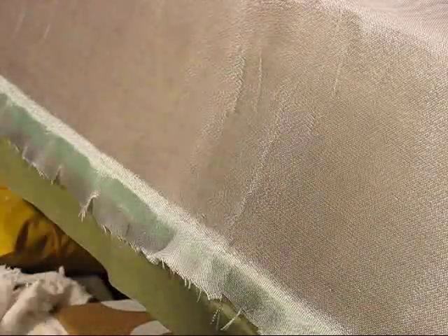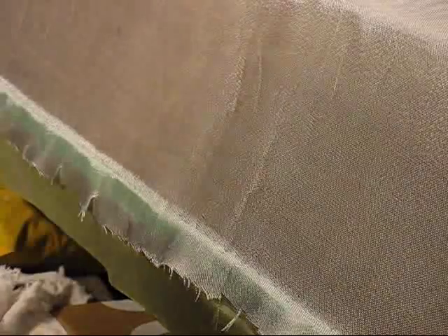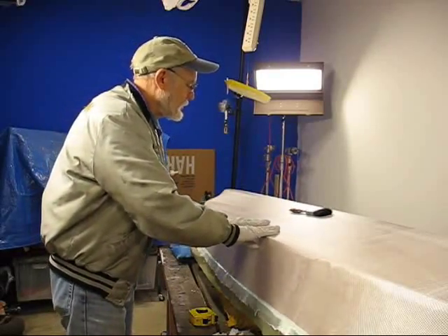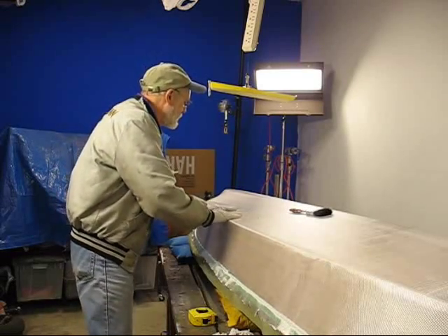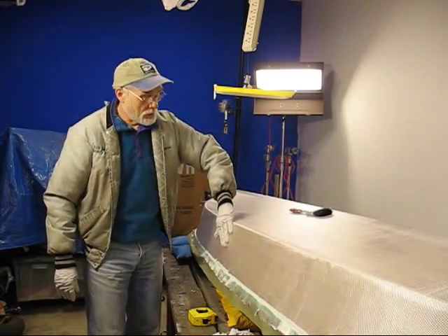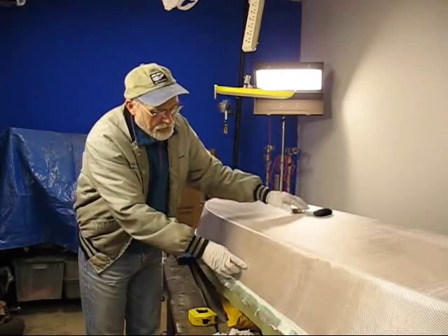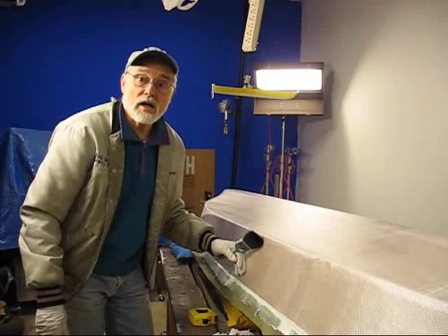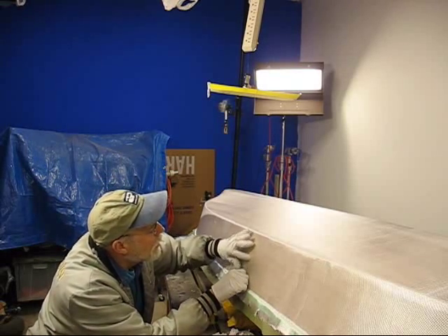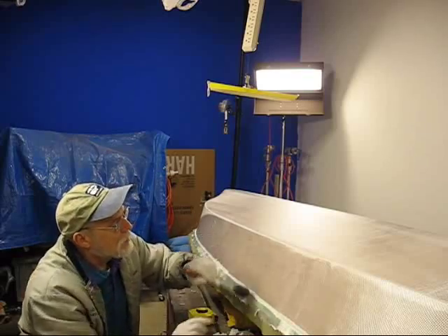You even out the glass in that spot, because if you delicately feel it you can feel a little ridge in there. One of the other things I've been doing is going along looking at these spots — there's a little bubble, I'll chase that to the string. Close your eyes if you see a spot you think may be a problem; if you feel something, it's a pressure ridge which may give you a line through the paint. Scratch it around a bit and it's gone.